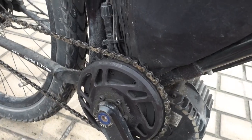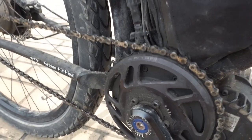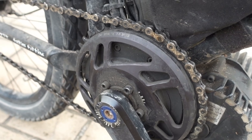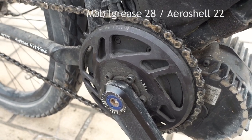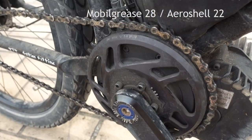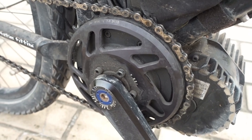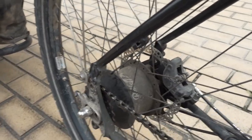This is an aftermarket Lekkie Bling Ring 42-tooth — I think that's really a must with this motor. Behind the chain ring you've got the big internal gear which is part of the motor system. Clean off as much of the factory grease as you can and pack it with the right grease — Mobil 28 is the one accessible to Europeans, or Aeroshell or similar. It needs to be a specific type of grease that doesn't degrade plastic, because there is a nylon gear at the back.